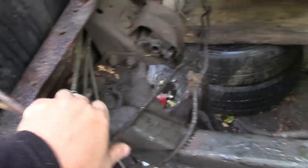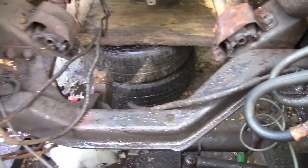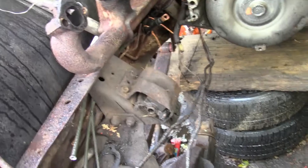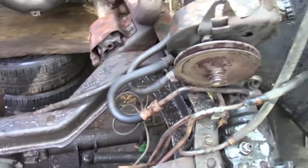The frame still needs work — I've got to plug the hoses off so I don't spray down into them. Get a good blast in there and maybe try some of that oven cleaner on it and see how it does. It seemed to work pretty good on the block, so I'll soak it down real good and give it a good blast.